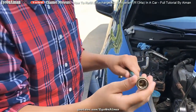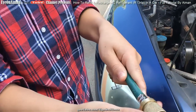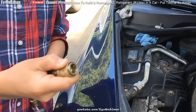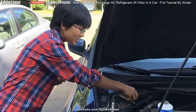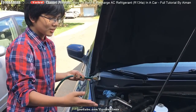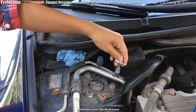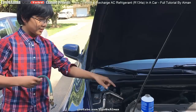Let me explain this hose. For safety reasons, it has a particular way of connecting — with two fingers you press it back, then put this end on the connector and let go, and that should secure it. Now there's a needle inside here, and when you press down on it, gas comes out. If that gas is not cool, that's an indicator you need to refill.